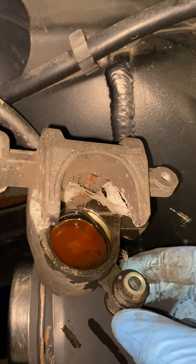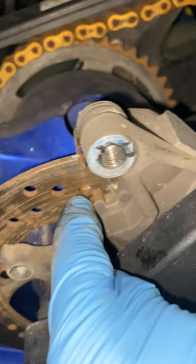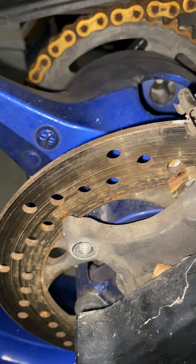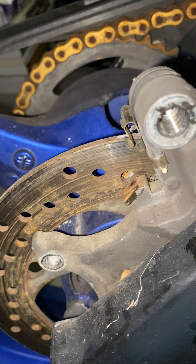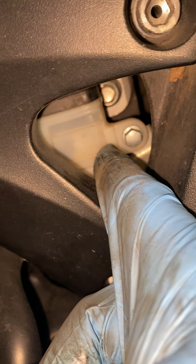Pre-fill the slave and shove the cylinder all the way down — that's the best way. These seals are very important because you need as little friction as possible when the pads are sliding back and forth, or when the caliper is sliding. When you put it back together and change your pads, this shim is very important — take it out and clean it. I don't really grease it; I'll just put a little bit of anti-seize on the pads, and that should be enough. You definitely don't want any of that getting on the rotors.